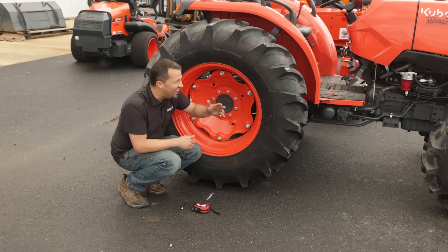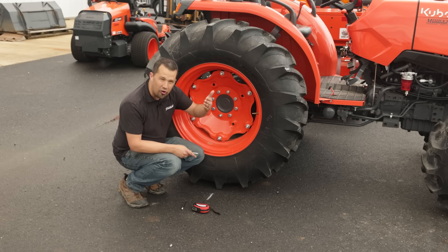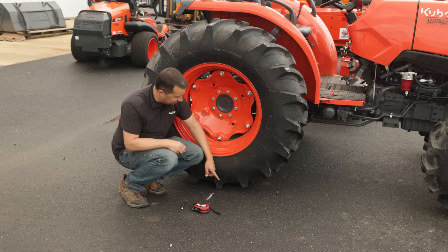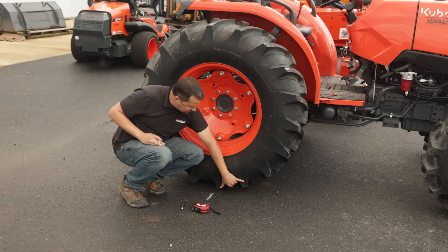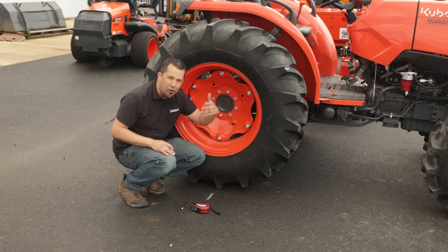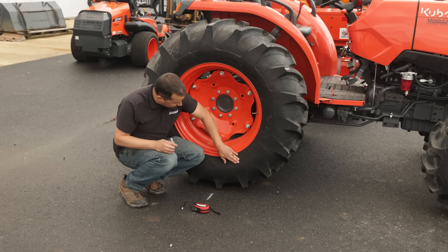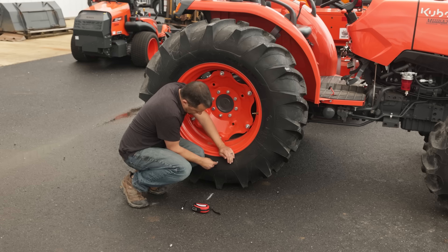As we're going forward and back, we're noticing that our line is not returning to the same spot when I drive back again. Interestingly, the difference between this line and this line is about a six-inch mark — that should be approximately what our lead is. So I need to go erase my first chalk mark and make a new one in order to measure the difference when we change our tire pressure.